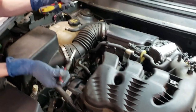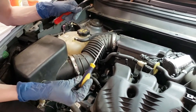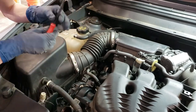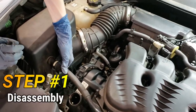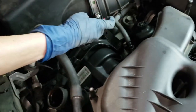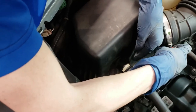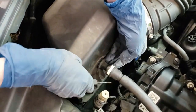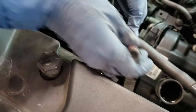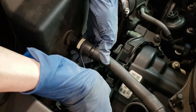I've just got a few of my favorite tools here: a short very tiny screwdriver, a long kind of tiny screwdriver, and a pry tool. I'm going to start with this connector and it'll be a lot easier if you just kind of coax — these are super, super breakable — so it's a lot easier if you just coax the ends up from the bottom instead of prying from the top.